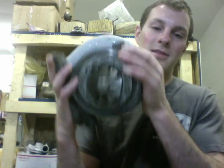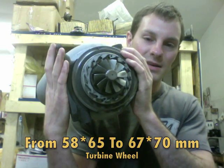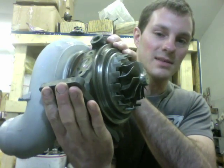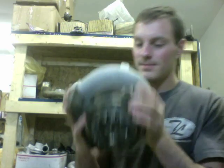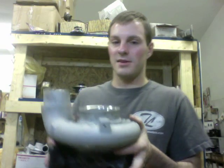For the turbine wheel, we upgraded from a 65x58 to a 67x70, and we also made a 10-blade turbine. For this upgrade, we have to machine the compressor housing, the compressor plate, and the turbine housing. I'll go ahead and pull up the turbine housing to show you what it looks like machined.